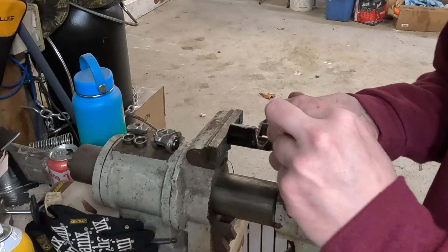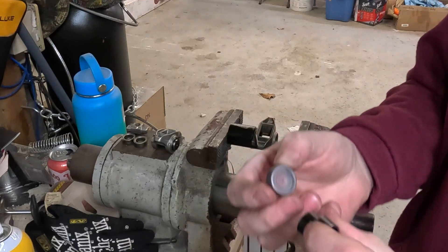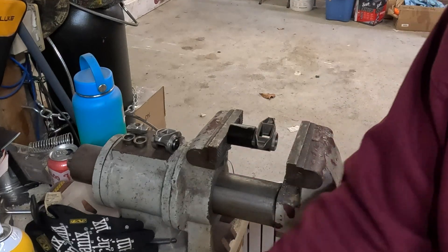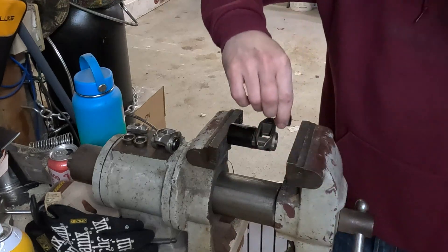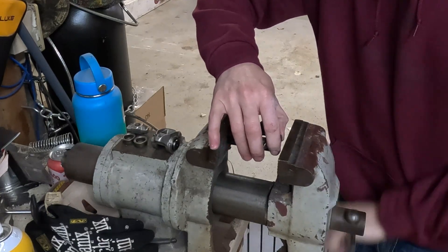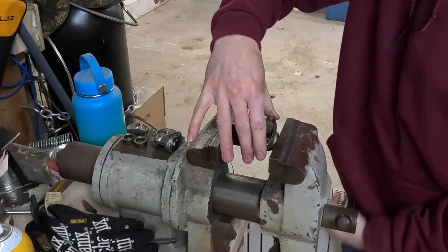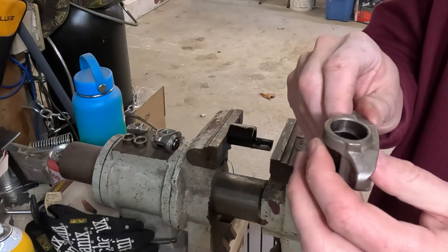It's critical when you install these bearings — there's writing on the outside edge and you want that writing facing out. These have caps in them also. Since we're going to be installing it facing out on this side, I'll go ahead and push out the plastic bearing retainer sleeve. Then I'm going to install it over my device here, which is used to align that bearing when we're seating it. We'll get this thing started and run it down pretty much flush with the rocker arm.